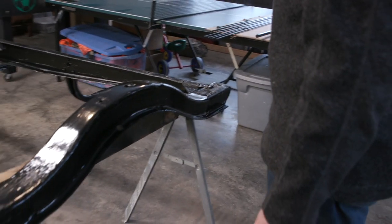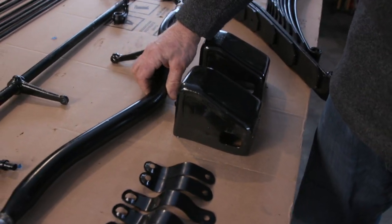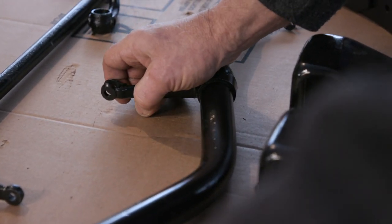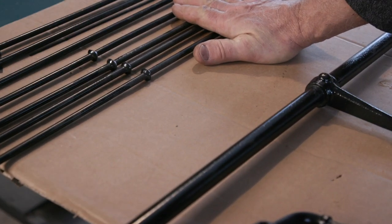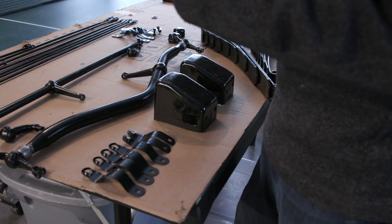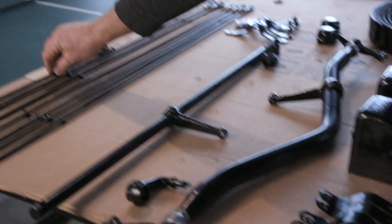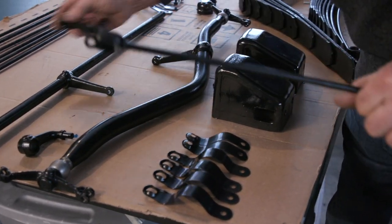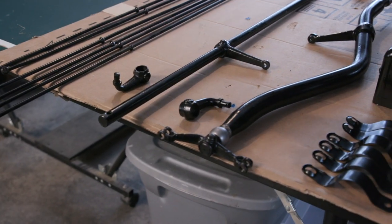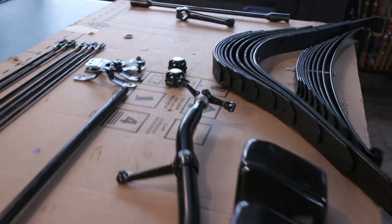These are the brake parts. The brakes are operated by this shaft — a piece hooks to the brake pedal and two levers attach to four rods, two in the front and two in the back, hooking up to the four wheels. There's no hydraulic system — it's all mechanical. The emergency brake hooks to the emergency brake lever, with levers on either end connecting to rods hooked to the rear end.